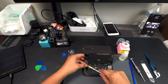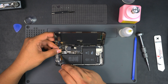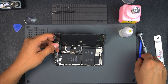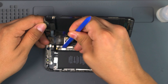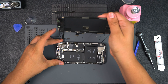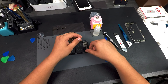You want to be careful not to damage this ribbon cable right here or we will lose Face ID. I like to use this little tool just to cut through the adhesive. Whoops — I actually unplugged the wrong one. It's this one right here. All right, let's go ahead and remove this and put our screen off to the side.